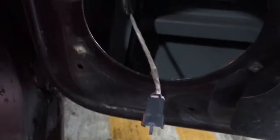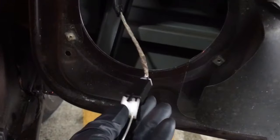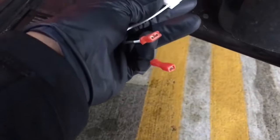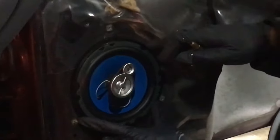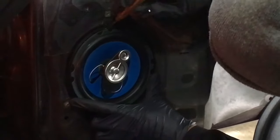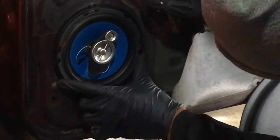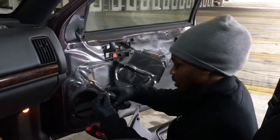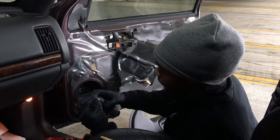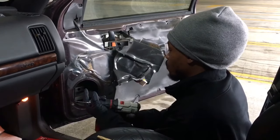Moving over to the door, you'll notice the factory connection — that's where this end of the harness goes. You just slip this in when you're ready, and those two wires go to the speaker. Now we need to focus on mounting it, so I'm going to drill some holes. The way I do this is I loosely put the speaker on the door, then with a center punch I scratch marks for where I want my screws to go. Then you take your drill, put your drill bit in, and drill the holes.